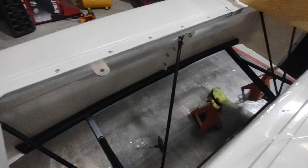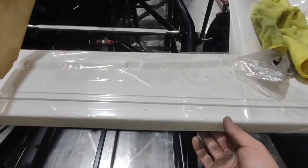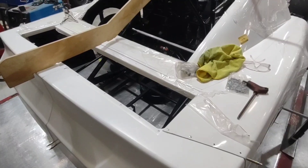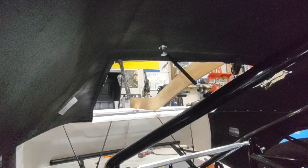I've got my aluminum body supports. I may end up adding a couple more that go up to the back of the spoiler off of that center tab. I also have to use that center tab and may add another one to support the front of this rear deck, the back of the windshield. When we get the window in it, that's going to act as kind of a gusset with the tin, but for now it's a little bit weak and a little low. I may support that up. Got the roof mounted with my roof supports - I like using these spoiler supports up there; it's clean and gives you a little bit of adjustment.